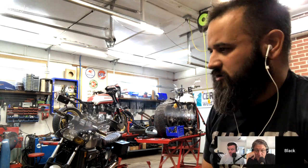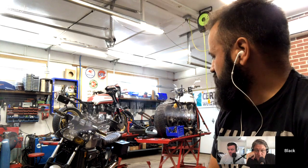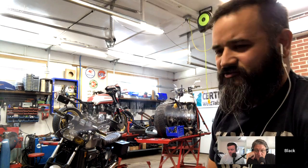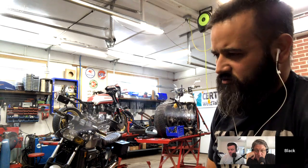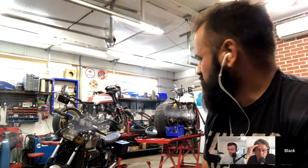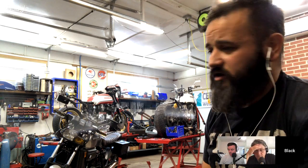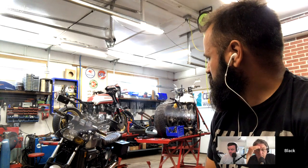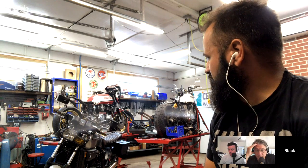That was one of the projects that I brought to school, and another female student worked on it. We put a Dyna 2000 ignition in it, a Rick's electronic starter solenoid, a new battery, and we got it running. But it still needs a lot of work. I'm gonna piss a lot of purists off, but the bike's gonna get cut up.